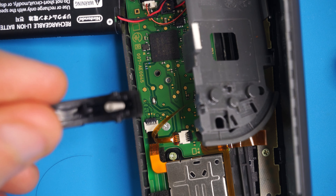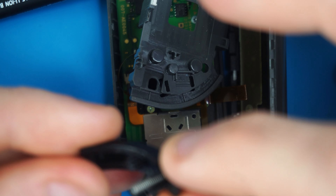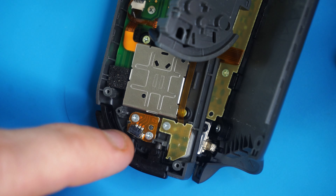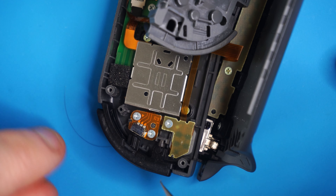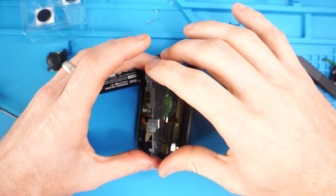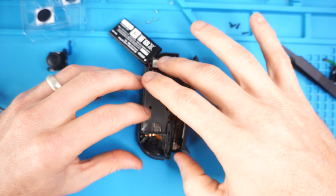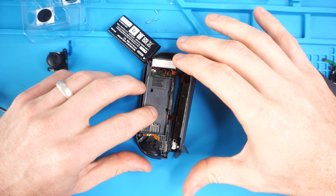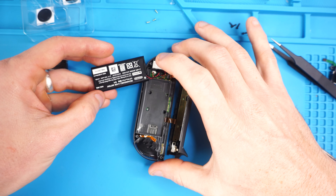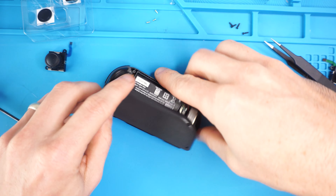Now we're going to do the reassembly. The L button probably knocked off — the spring hopefully is still connected and goes on to a little plus sign. The spring rests in the channel and then get the lip of the button underneath the case on each side. Rotate this level of the case back, make sure your battery is out of the way, and this helps hold the button in place with the two layers. Once the battery cable is out of the way, it should lay flush. For this Joy-Con, the positive side of the battery goes down and the negative side goes up, with the cable sticking out of the left side of the case.